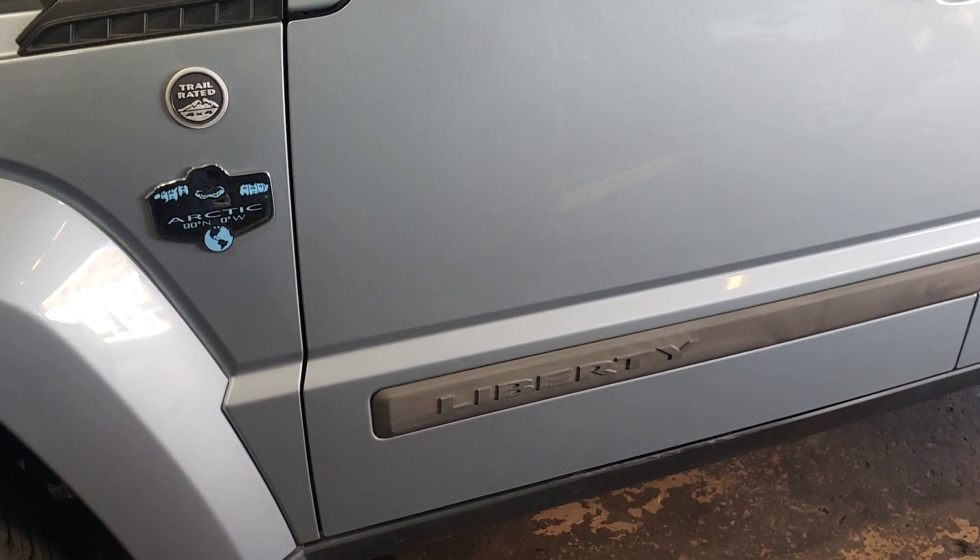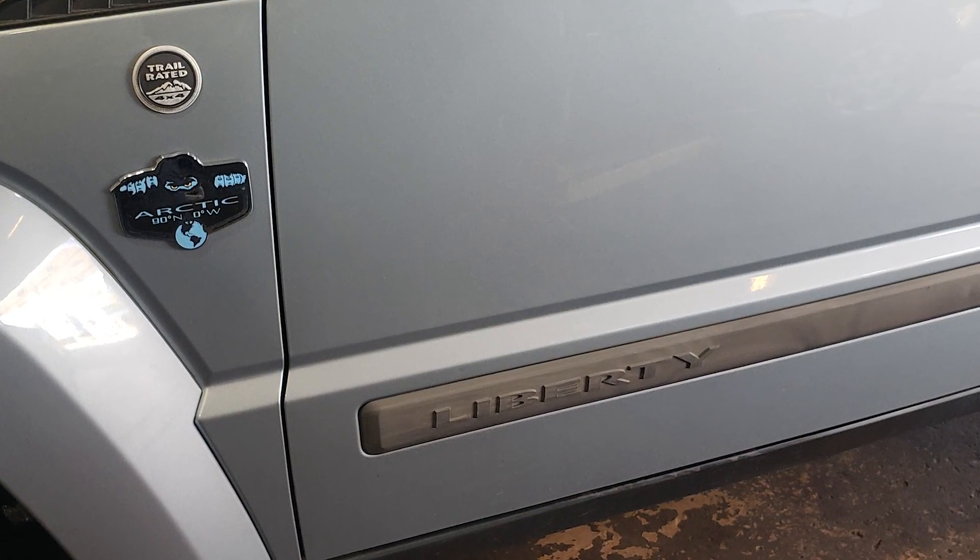Today started out pretty good with a 2011 Jeep Liberty. The customer had put in a new TIPM. I told them to push down all the fuses and make sure they're all pushed down - they come in these little brackets when you buy a new TIPM. They said they did it, but of course they didn't. Usually you just push the fuses down, clear the codes, and it's all good. But this vehicle ended up having to get the seat weight sensors relearned for the OCSM. We went ahead and did that procedure, got that taken care of, and we were all good there.